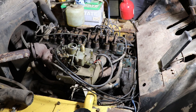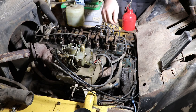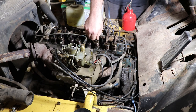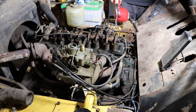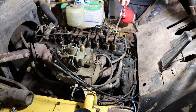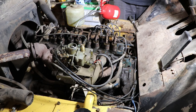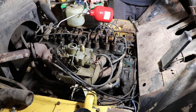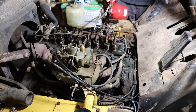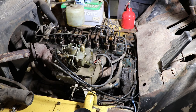So we're good there. Now we need to do a couple of things. We're gonna verify the valve lash. That one's tight, loose. So that seems good for just the initial check. Pour some oil on just about everything here. I suspect that this is going to be loud when we first start it up, because I've taken the oil out of everything. I could possibly take that screw out and fill up this cavity.